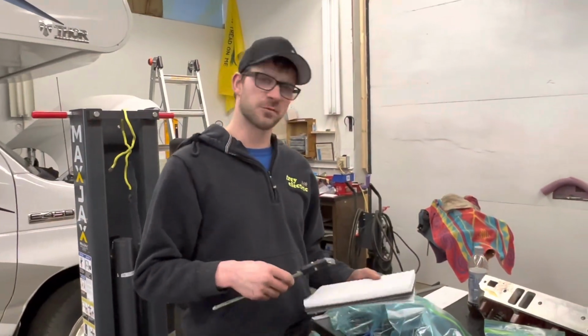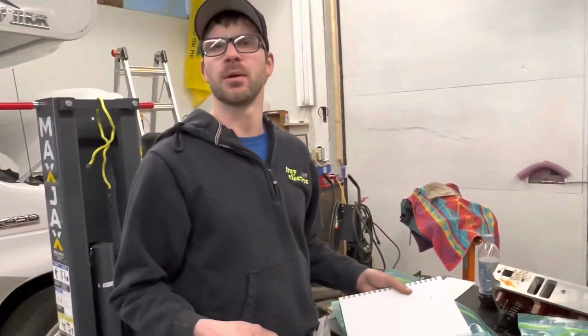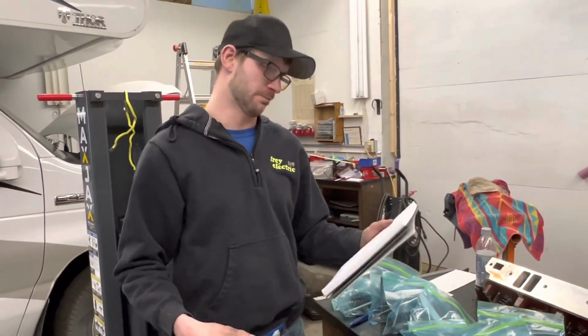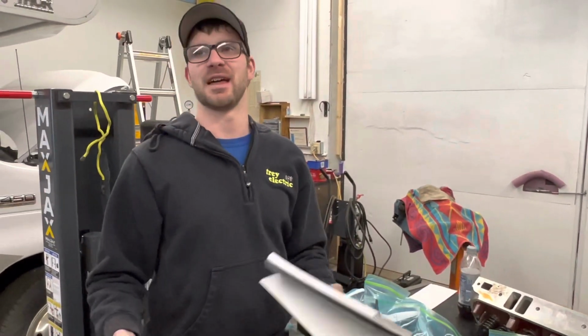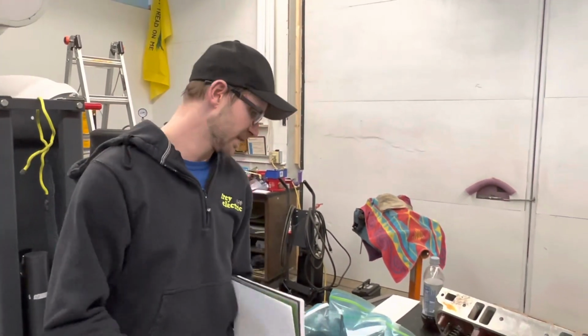We checked the valve spring free length and obviously wrote them all down. We think we're going to run them a whole nother season because the difference between the shortest and tallest is 3/100ths. Not enough to matter right now for what we're doing. You can't really tell a difference lining them up. Why we changed them our very first season is you looked at them and it was like this. Yeah, link the video to that. That was pretty telling. It was pretty bad, but these seem all right, so we'll run them again.